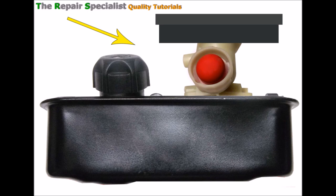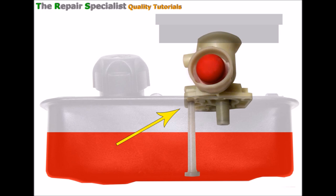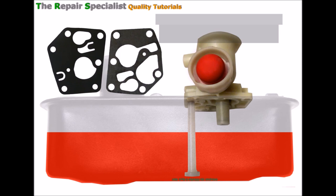So in order to effectively show you how this carburettor works, I've got to show you the workings of the whole complex — the air filter, carburettor, and the fuel tank together. So let's imagine now we've got x-ray vision and we can see inside the fuel tank. We can see the fuel pickup pipe here protruding down into the fuel, shown in red. The bottom of this pickup pipe isn't quite touching the bottom of the fuel tank — that's purposely designed so that any crud that weighs heavier than fuel will lie on the bottom and won't go up into the pickup pipe.